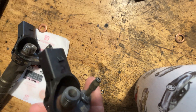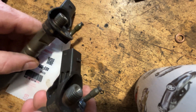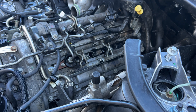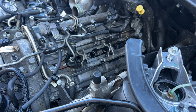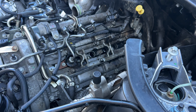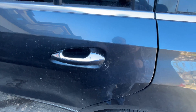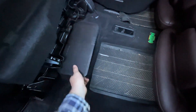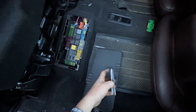Let's get these in and see if they're leaking and if this repair was a good job. One thing I did was pull the fuel pump fuse — it's under the back seat — and then turned the engine over three or four times to blow out any carb cleaner that leaked down into the cylinder. Under the back seat you can find the fuse diagram — fuel pump is right there, fuse F132.